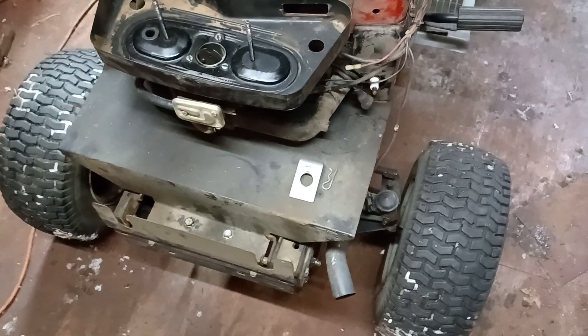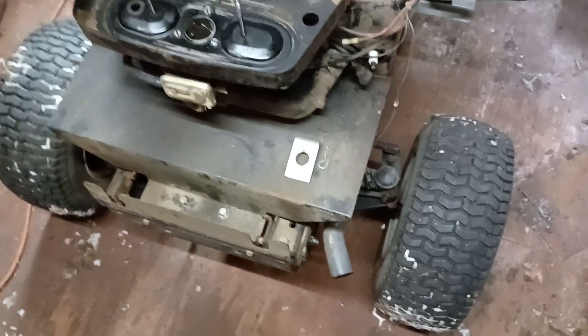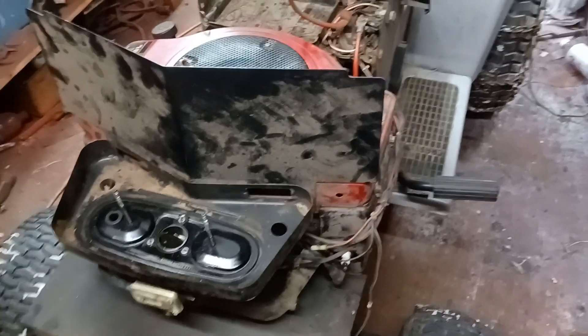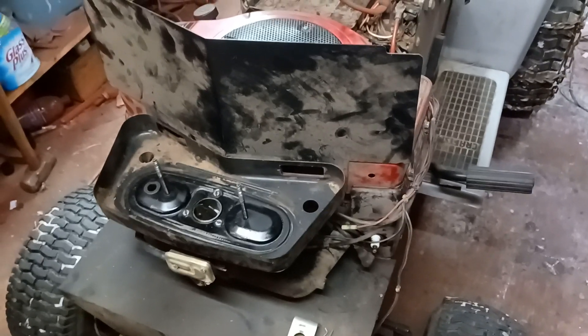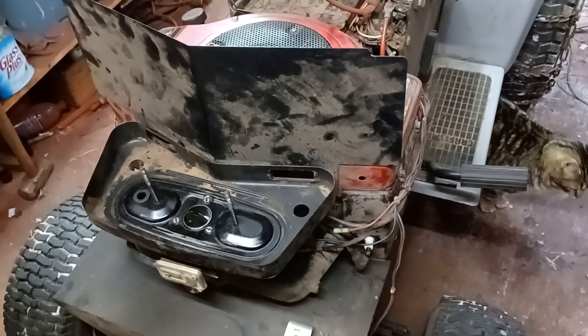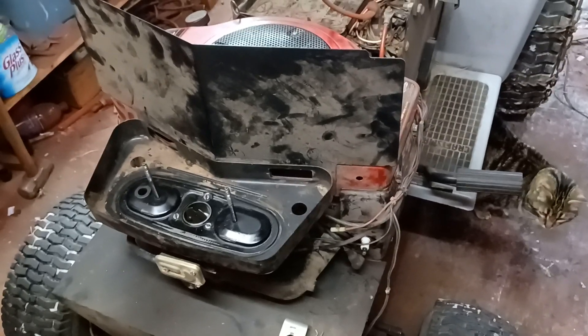Of course he wants it. This thing doesn't have spark, and yeah, I could throw another coil on it, but why? I could be pushing all that snow and it lets loose, and I'd have a major mess on my hands. Because with that bottom crank seal — it's not leaking — but with that journal being worn out, it can start leaking at any time and could actually drop the seal altogether. I've seen it. I've seen these twins with excessive lower end play, and it's not pretty to keep oil in them.